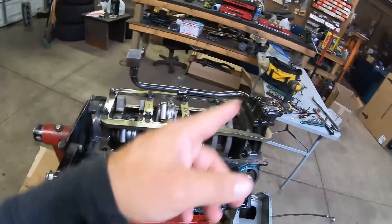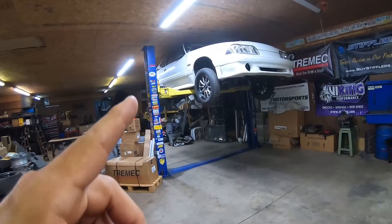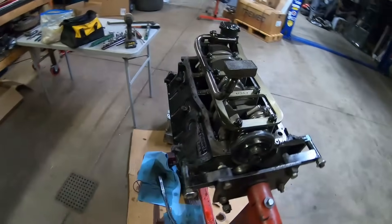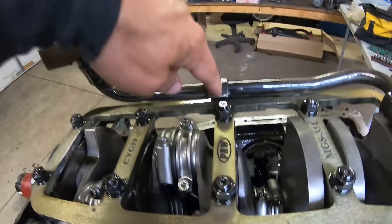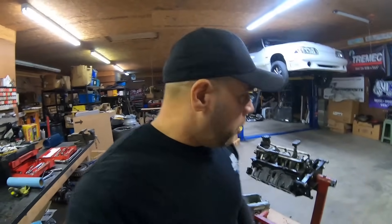We're back in the shop today. We're going to go ahead and get right into getting the rest of this motor torn apart. One thing I did want to point out - this tab right here is one of the main reasons why the 363 wasn't in my Fox body to stay. When I first had the engine in the white Fox body with the turbo kit, my oil pressure would go up and down, fluctuating between zero and 40 PSI. What actually happened is this tab rattled and cracked the tube in the old Moroso oil pan, right where my oil pressure line connects. The oil pump pickup just cracked in half. It wasn't fully broken yet, so I was still getting some oil to the motor, but I definitely starved it a little bit and the bearing showed it a little. That's where we got into the 408 build.